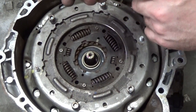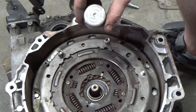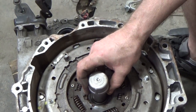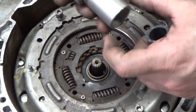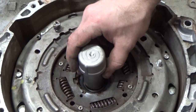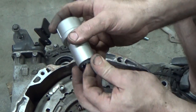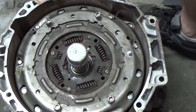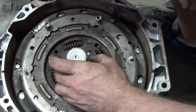However, like I mentioned, we have this 1-inch Schedule 40 stainless steel. This is machined down on a lathe, and then I put a center starter bit in there just to give something for the pusher to center itself on. And it's just a little bit smaller than the outside perimeter of this collar. So the inner race is going to be able to slide over top of this. However, if it gets off alignment, it's gonna have a collision. So what I found is a piece of 3/4 inch heater hose fits almost snug. And once I put it over top of the input shaft, I put this there and it virtually centers it for me with very little movement, if any at all, that will interfere.